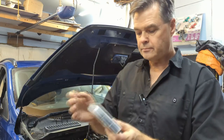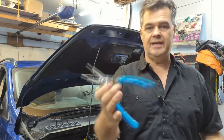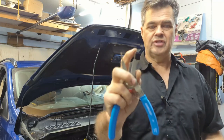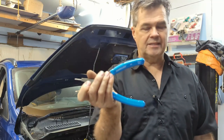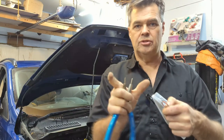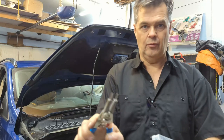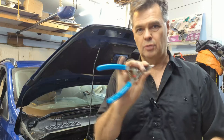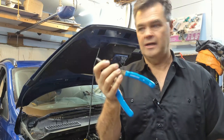This is the snap ring we're talking about. I put it in my vise and took the two pieces apart with snap ring pliers — you'll want to get yourself a good pair. I use Channel Lock ones; these are the actual ends I used. It comes with several different ones — some are 90 degree. Don't go with a cheap set of snap ring pliers for this; that snap ring is really in there. When you put it back in, push the two pieces together in a vise — not on the heating element, go on the edge — then put the snap ring back in. You'll have to fiddle with it some but you'll get it. Channel Lock makes a good product.